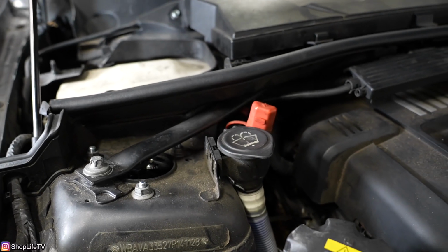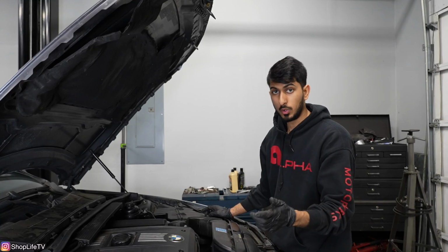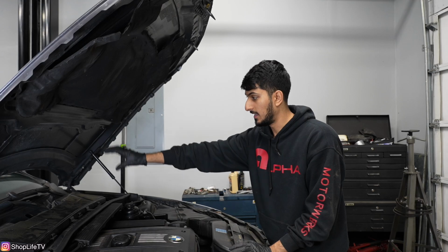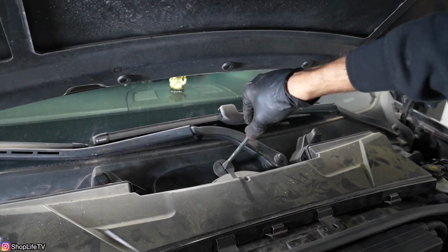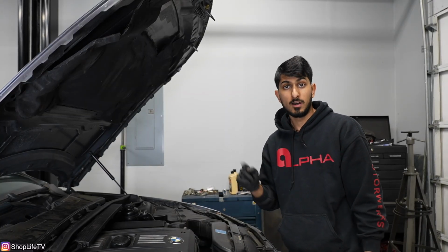Once you have your adjustments done, I would actually remove these and leave them in the glove box because they're not just fitted on there. Then you can go ahead and reinstall the strut bars, torque all that stuff down. The bolt on each strut tower is an external Torx 14, and you want to make sure it slides into that external Torx 18 in the middle of that windshield. Make sure they both slide in, and then you want to tighten that one down as well. All the torque specs will be listed down in the description box. Let's move on to the rear.